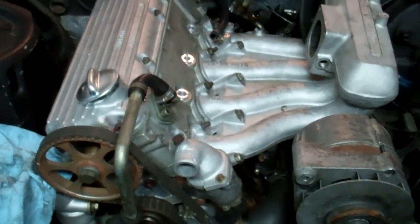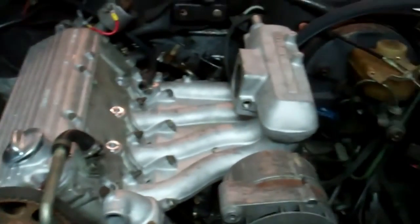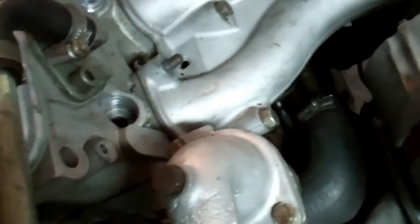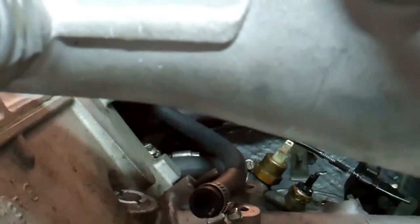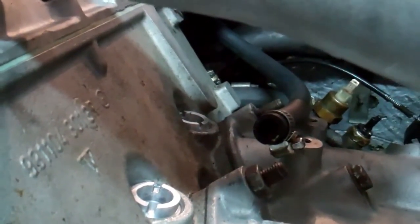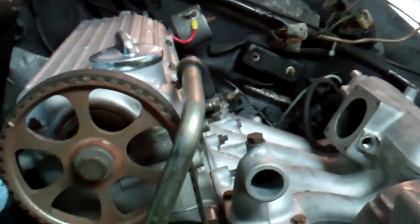But other than that, we're rocking and rolling. Last time I worked on the fuel system, I ran into a problem trying to fit the fuel rail underneath the charge tube from the turbo to the intake and throttle body. There's a very small amount of clearance right here, and this is obviously metal, so it has no give. If something is too high, it simply won't fit. The problem was that the fuel rail would sit too high and hit, and then it wouldn't connect with the throttle body — because the injectors were too long and made the fuel rail sit up too high.